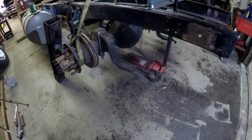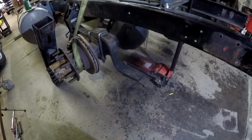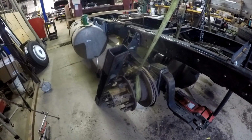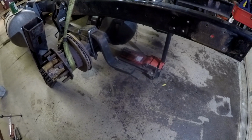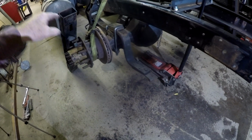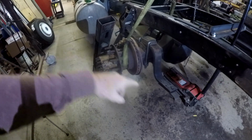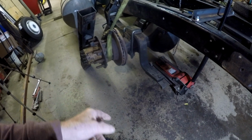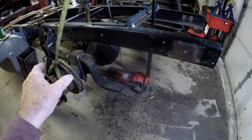Okay, here we are back behind the truck again after I just shot that clip regarding those bolt lengths and why I didn't think it was threaded into the trailing arm of the air suspension. So here it is. Both sides are bolted up, and if I didn't explain it well enough, the reason why I took that tube off, or that cross support member off between the two trailing arms, is because I was having an issue getting each side lined up